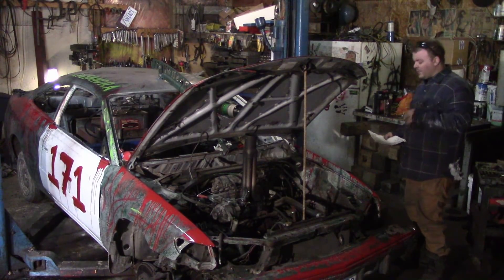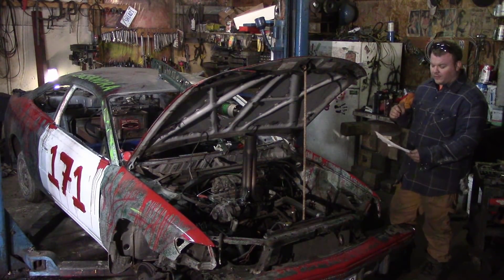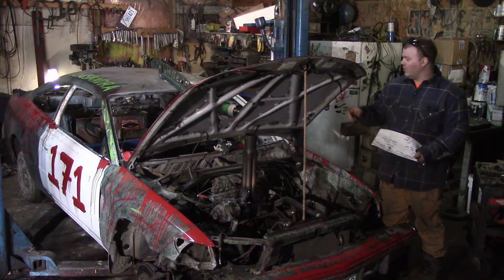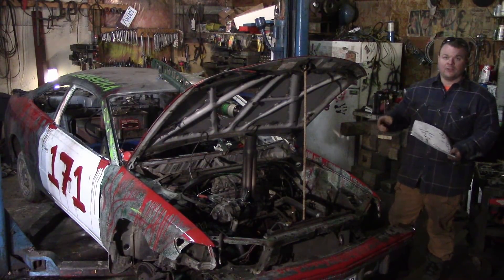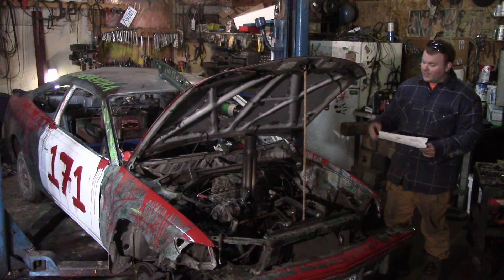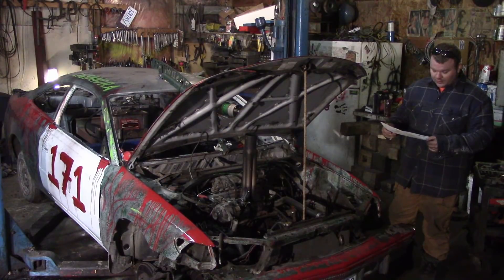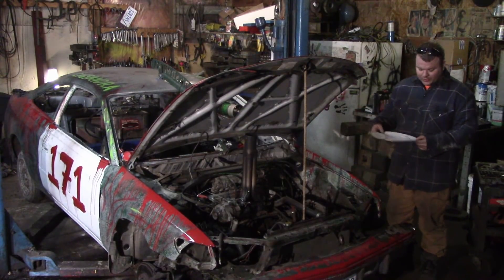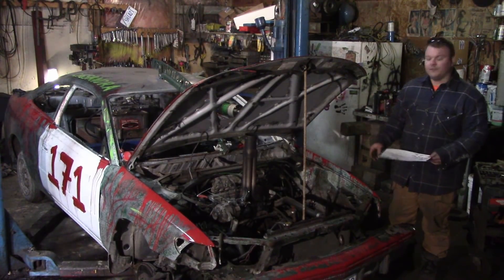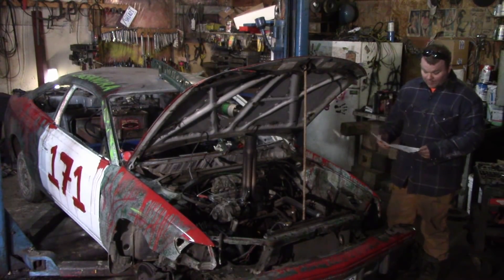I've come up with a list of the things that we need to do to this car. It includes door bar, push the spare tire up, take the main power from the alternator to the battery so that when I turn the alternator on it does charge. Fans need to be wired in. I need an alternator belt. I still have a driver side airbag. I need to hold off on the threaded rod for the hood for a bit.